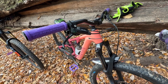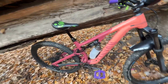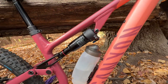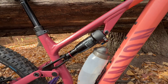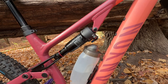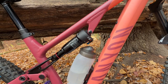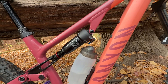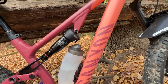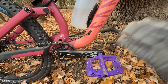The shock is another area where the Canyon comes out ahead of the Stumpjumper. They put a RockShox Deluxe Select+ on here, which is significantly better than the X-Fusion shock you see on the Stumpjumper. The Fuel EX5 also comes with that X-Fusion, as do a lot of other bikes — even some Polygon models at lower specs. That X-Fusion shock is absolutely awful to try to tune, so it's really nice to see the Deluxe Select+ here instead.